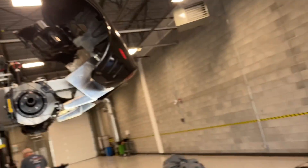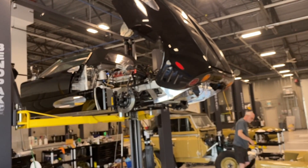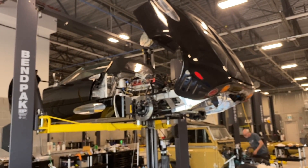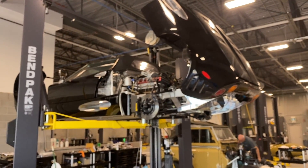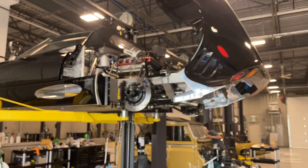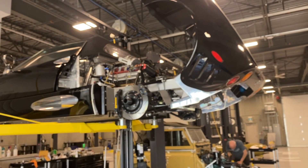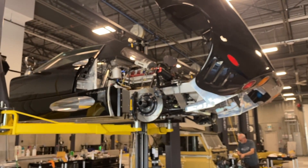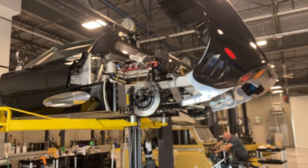The construction is very racy — this would be the way you'd build, or used to build, a race car. Of course now race cars are carbon fiber, but they'd still have a carbon fiber tub. A race car might have the suspension bolted right to the engine and the engine bolted right to the tub to save weight. On this car, the engine sits in the monocoque and the suspension is anchored on the monocoque. I don't know of a road car that's ever had the engine as a stressed member — there'd be too much vibration into the cabin.